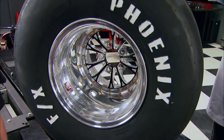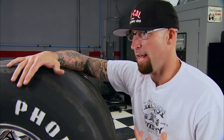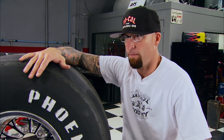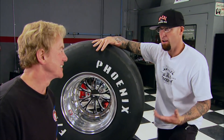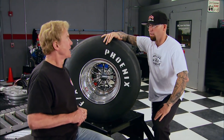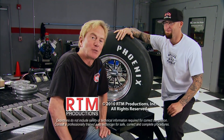This one looks similar but it's a PH56R, also known as a 14x32 radial. The primary benefit of a radial tire is that you can run a higher tire pressure, which results in lower ETs — really important in classes such as super stock and comp eliminator. There's a lot of science to this tire stuff, and more applications are coming. They're working on a line of Outlaw 10.5 tires with stiff sidewalls for high-horsepower, high-weight applications, and also looking at big-tire programs such as the 17x34 sixes used in nostalgia fuel cars, top dragsters, and pro mods. Good luck at the track!